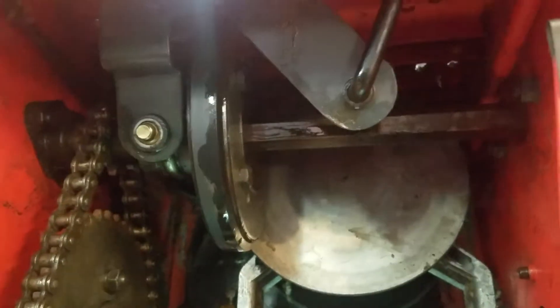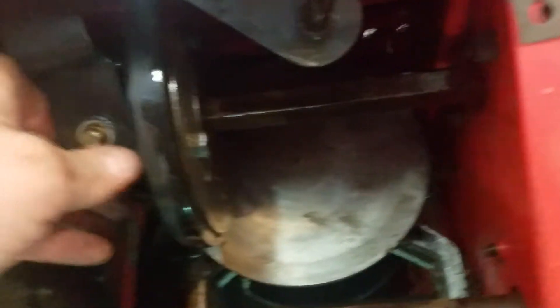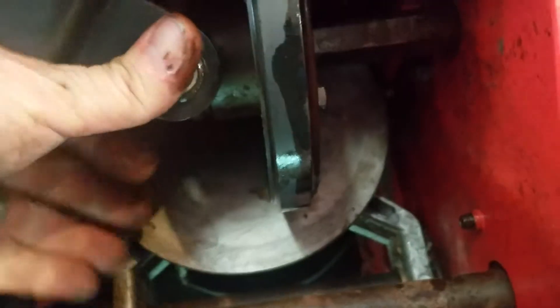PB Blaster and a hammer. I also took a wire brush — either a small wire brush or a larger wire brush — and brushed off all the crud along this bar, then lubed it up a bit. This will go over into fourth or first gear in the center, and actually when you want to go into reverse it over-centers on that big wheel on the back.